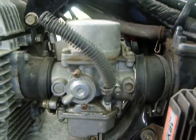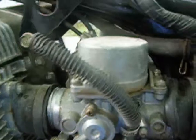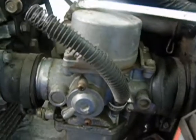And this bar. So that will be the project — pictures will go on forums and I will figure out how to get this thing off, cleaned, and on the road. As you can see, disconnected the front end by pushing up the back end here. It's still attached to the air box, just jammed up there. If anybody wants to know how it's done: use a big screwdriver, apply pressure here and here while pulling back on the actual carburetors — plural, there are two. Pulled back on those while doing the pry business, and sure enough they came out.